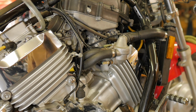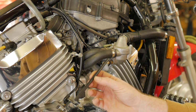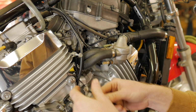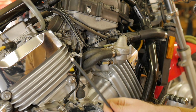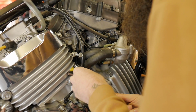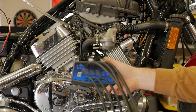What's also amazing, I don't know if this is what it's for or not, but inside of their packaging they had this spare line, and I was at first curious as to what it was for. But now that I realize that getting onto that with my fingers is nearly impossible, having a spare hose to screw something into, genius. Stupid simple. And once that is threaded in, we can pull our hose off, grab an 8mm socket, and just snug this thing up. Don't need to go crazy tight, I'm probably just going to leave these hand tight, just like that.